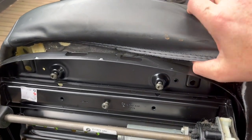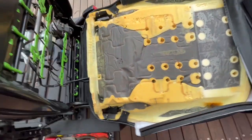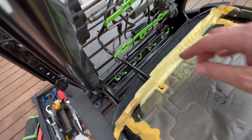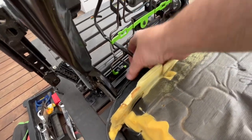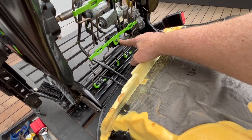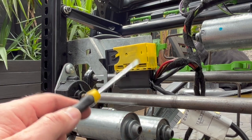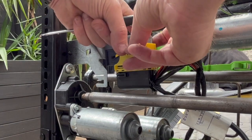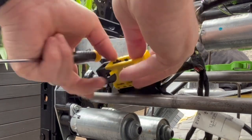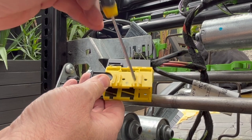What I did was pretty much just peel this back from here - it peels all the way back. One thing I found is there's a heater cable - no, that's the occupancy sensor cable, so that goes into there. And then this is the heater control. Now I've got the heated seat part, so this goes up into here and I'll just remove this from its cradle.